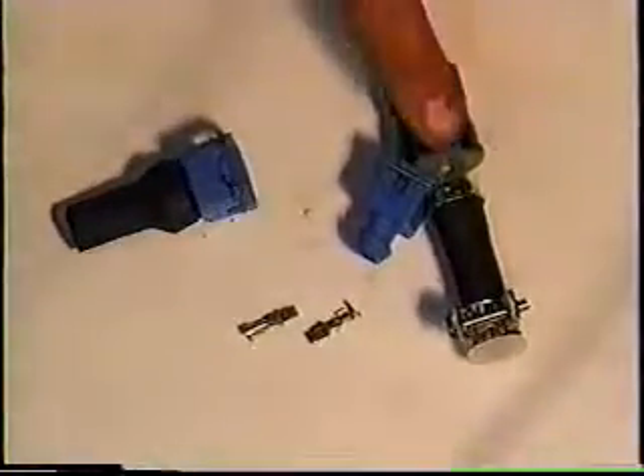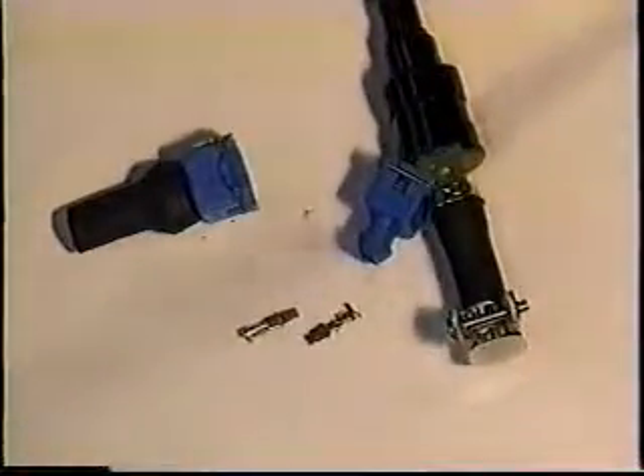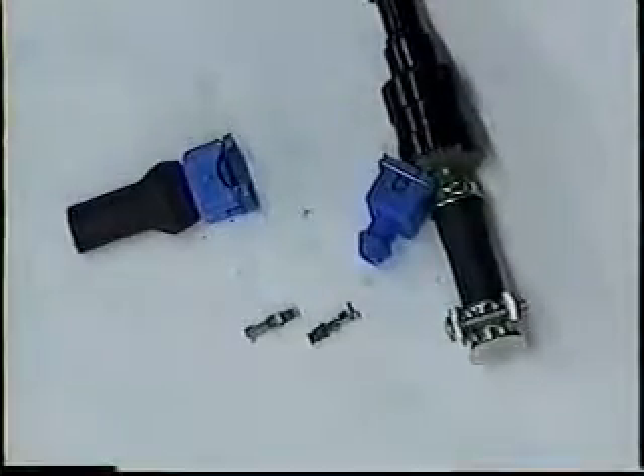One of the things you've got to remember is that these injectors are not a 12-volt injector. You never, ever want to test one of these with a full 12 volts from the battery. These are functioning on approximately 3 volts — very low impedance. If you test these with 12 volts, you'll fry them instantly. All you have to do is arc them and they will be dead.